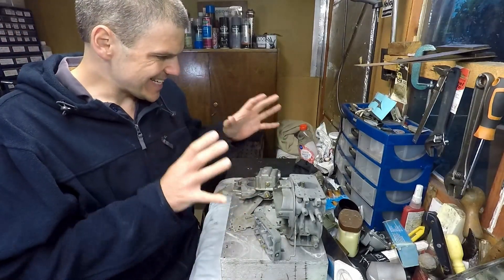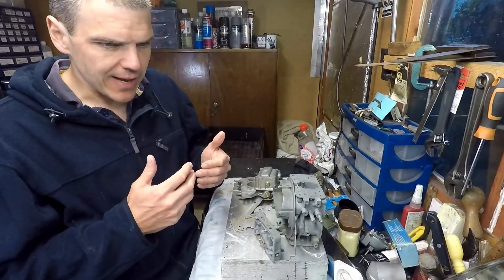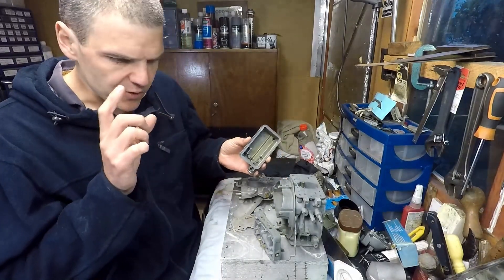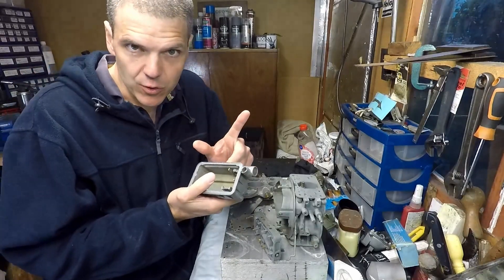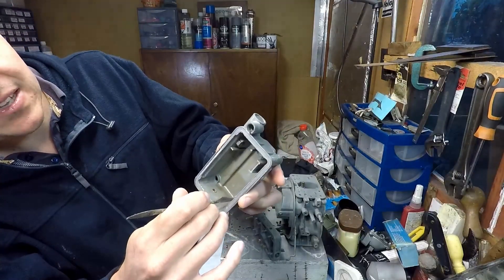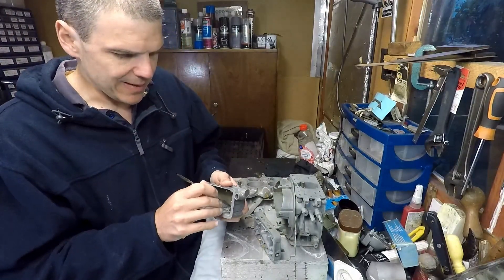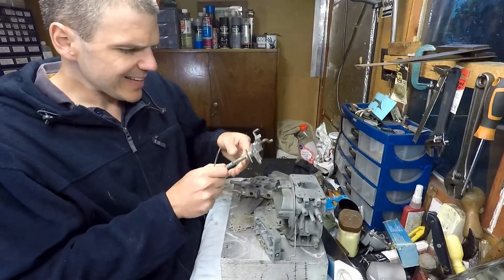This is the result of the cleaning process, and this unit has actually been a very good example to stress my point about cleaning anything before you put it away in storage — because it allows you to diagnose faults. For example, I thought I had a spare secondary fuel bowl, a 4150 fuel bowl, but as it turns out it isn't really a spare. When I started cleaning it, I found all sorts of holes and some epoxy — evidently this fuel bowl has a hole in it that's been plugged with epoxy, which isn't very good.